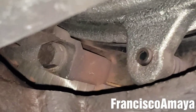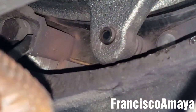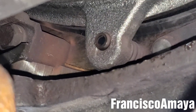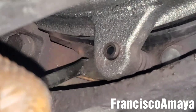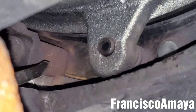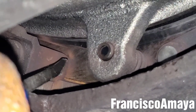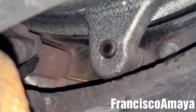You can clearly see the mark over there that looks like oxidation. That mark is clearly a sign of wear — this means that the clutch is moving around, vibrating left and right when the truck is in motion. And you can clearly see the flywheel is resurfaced right there, but for some reason the clutch is not touching the surface of the flywheel, and that is the reason why we are getting this vibration.